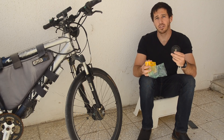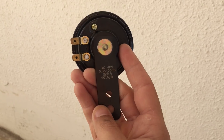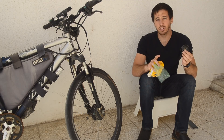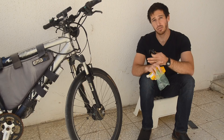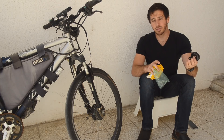The other nice thing about these horns is that they're designed for higher voltages. They come in 12-volt versions, but this one is a 48-volt version, so I can run it directly off my 52-volt battery. You can go a little bit up or down from the rated voltage. They make these for 36 volts — I probably wouldn't use a 36-volt one for a 48 or 52-volt battery — but 48 volts is fine for a 52-volt battery. They also come in 24-volt and 12-volt versions.